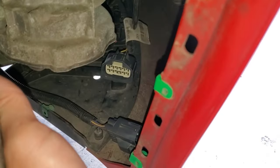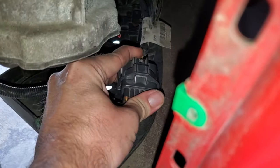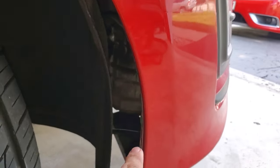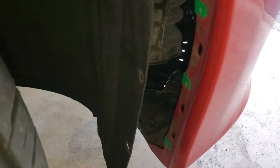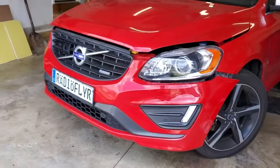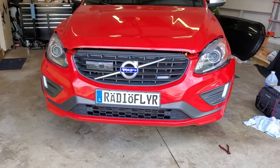We're now on the passenger side of the vehicle going through this wheel liner to attach the main bumper electrical pigtail harness. You should hear a nice satisfying click — that means it's in place. Because mine was hanging and the little Christmas tree clips weren't locked into the body, I had extra slack. So when you go to undo this procedure, I highly recommend going through the wheel liner first and then detaching it. Before we clip everything else in, we need to test it to make sure everything works — not only that fluid goes to the washer nozzles up top, but also that these open up and spray the headlights.